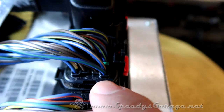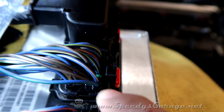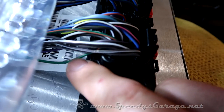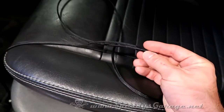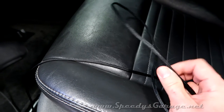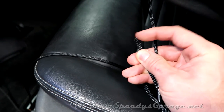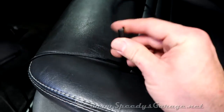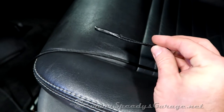Connector two is a little bit easier — it's pin 10 you want, the furthest right one in the top row, and it is dark blue with green stripe. So that's our RPM signal. The orange stripe on the dark green is our clutch signal. Here's the white and the green wire covered in loom, ready to run to the PCM and engine bay. This loom really makes everything look factory, but get the kind that doesn't fray. I've tried to save a couple of bucks and the ends get tricky to work with as they fray — so I have to put heat shrink over this after I run it.